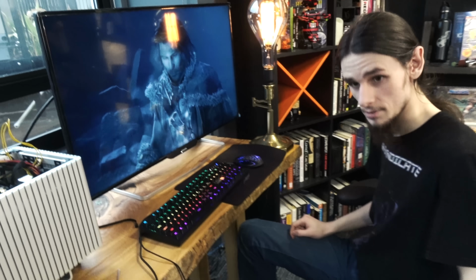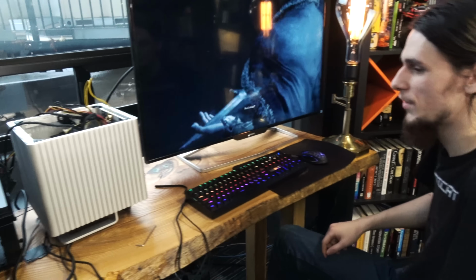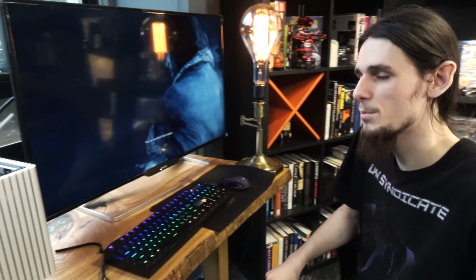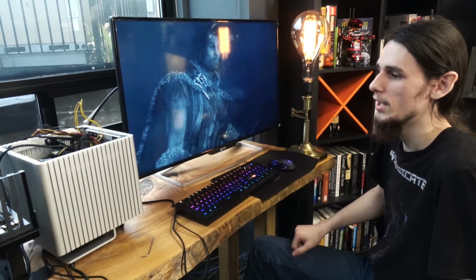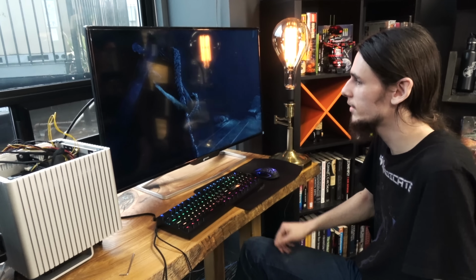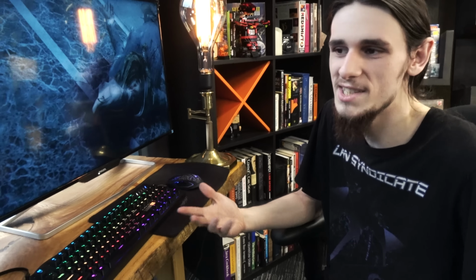So, put you on the spot, you got a closing salutation for everybody about this thing? On the system itself, I don't think it should be putting a 12-core, 14-core, or 20-core CPU in here, but if you do get one of the low-voltage units, it will handle it. This is running 1.7 gigahertz, 65 watts, about 60 degrees under load on all 12 cores when we did a stress test. My biggest thing is I really love the case.